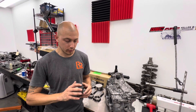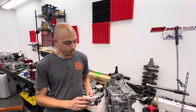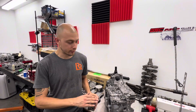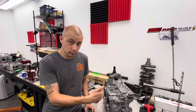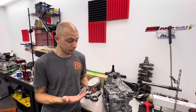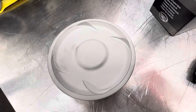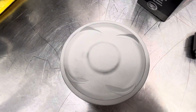It's also really porous so it retains oil, which keeps the piston stable. When the piston is more stable in the bore, the rings stay square in the bore so they seal better — you make more power and it lasts longer. For this option, we also put the thermal ceramic barrier coating on top of the pistons, another coating from Line-to-Line Coatings.